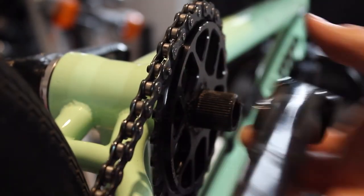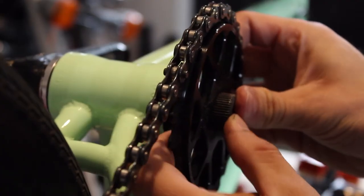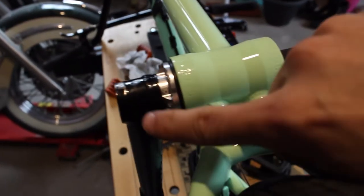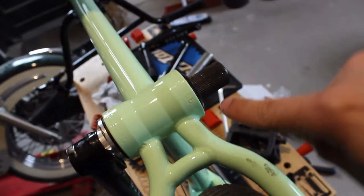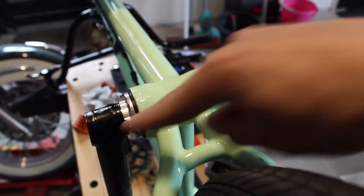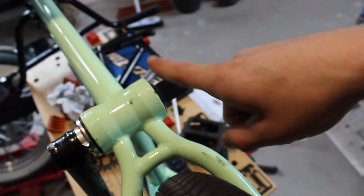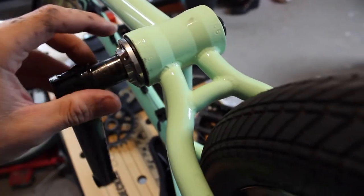In my case, I can just slide the crank right off. You'll see my sprocket is still attached to my axle. I have a spline drive, so I can just slide this off. You'll see on this side there's a spacer that had my sprocket up against it, and on this side there's a spacer. This spacer is there because you want your chain to be in a straight line, and this spacer is to space out the crank. If you're going to replace your cranks for the same cranks, make sure you check the spacers and just space them the same. But if you're going to do different cranks and they might have a different axle size, you want this gap to be the same on both sides, and you want your sprocket and your chain in a straight line. You can add or take away spacers there. I'm replacing my cranks for exactly the same cranks, so I don't have to mess with the spacers.